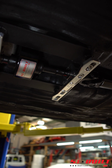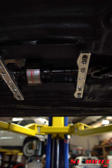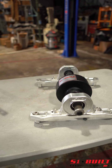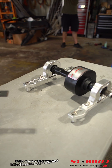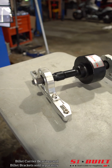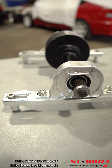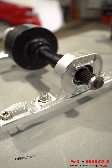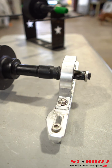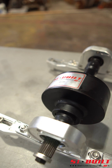What are some of the perks of running 60k CST fluid? One of the main perks is that it's going to give you more power to the rear wheels. The viscosity of the fluid is thicker, so it's going to allow the rear end to grab harder than the 30k would. It's going to give you a better shot out of the hole when you're doing any kind of racing, because it provides more power to the rear.